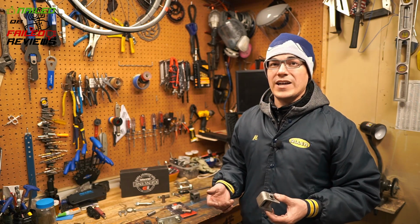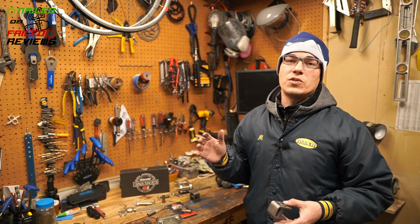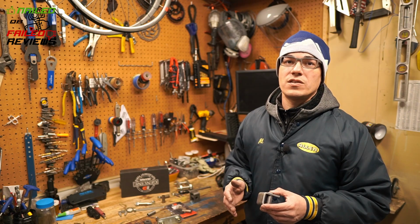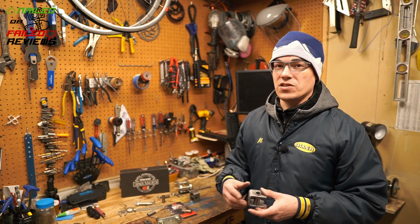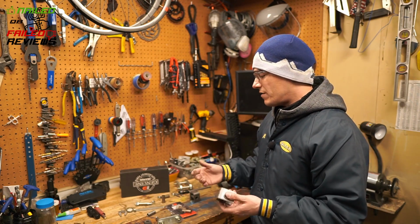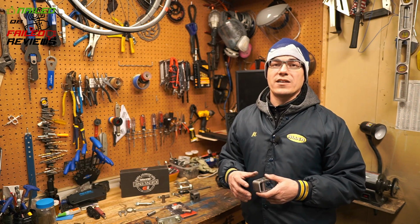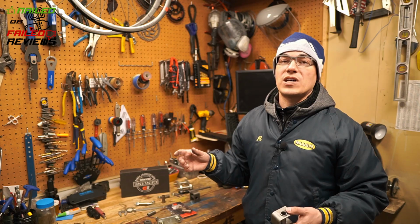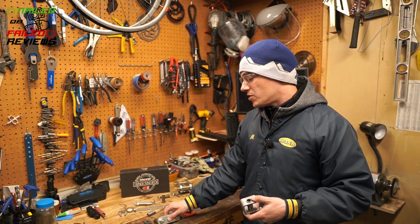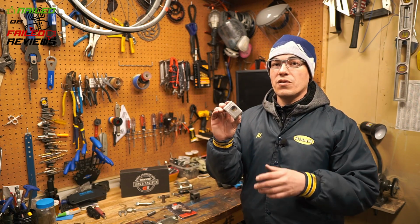So I went online, I said, well, is there a steel bushing that I could use with my regular drill bits to drill out the hole and then push in a bushing, essentially, just like you see here. What I found was that because of the normal size diameter drill bits, you're kind of limited on the availability of bushings that you can buy off the shelf, either online or locally. You know, the outside and the inside diameters, so that, for number one, you can get the bolt through it, and number two, you can press it through the hole that you're going to be drilling out.